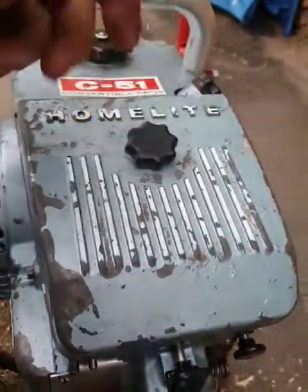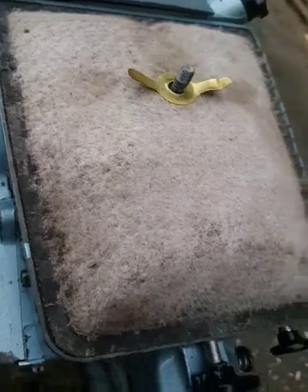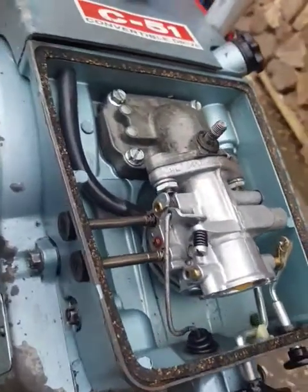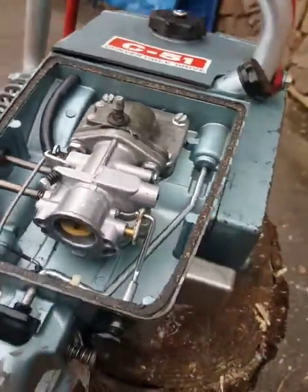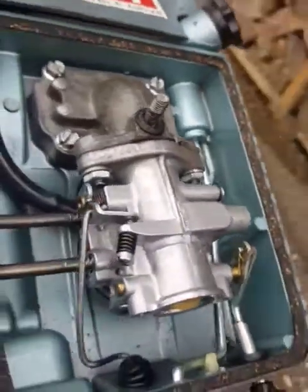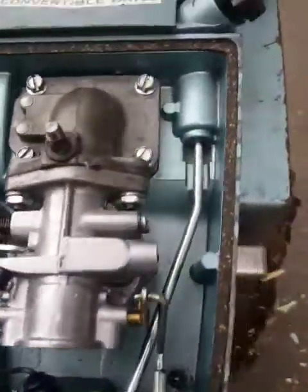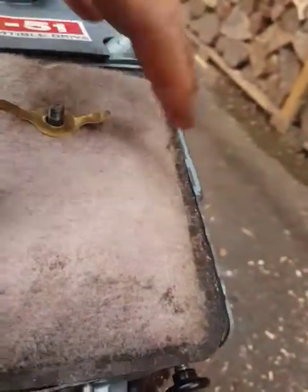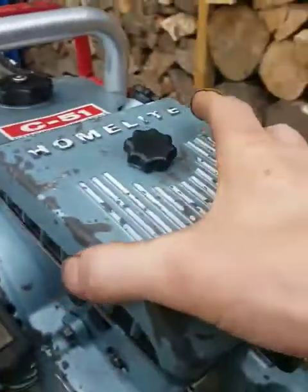When I had the saw, it wasn't running great — it was hunting slightly. When I spoke to a dealer who no longer trades now but used to sell Homelite, he said that even when you replace the carburettor gasket kit, sometimes they need another carburettor. So I ordered a refurbished carburettor — a real beautiful thing. That's the Tillotson HL141, or a variation of it; they do several different variations. Since it's been fitted, it idles really, really nicely. It's not a saw that I've cut with — I've run it and put it gently onto some wood just to see how the engine copes with it.